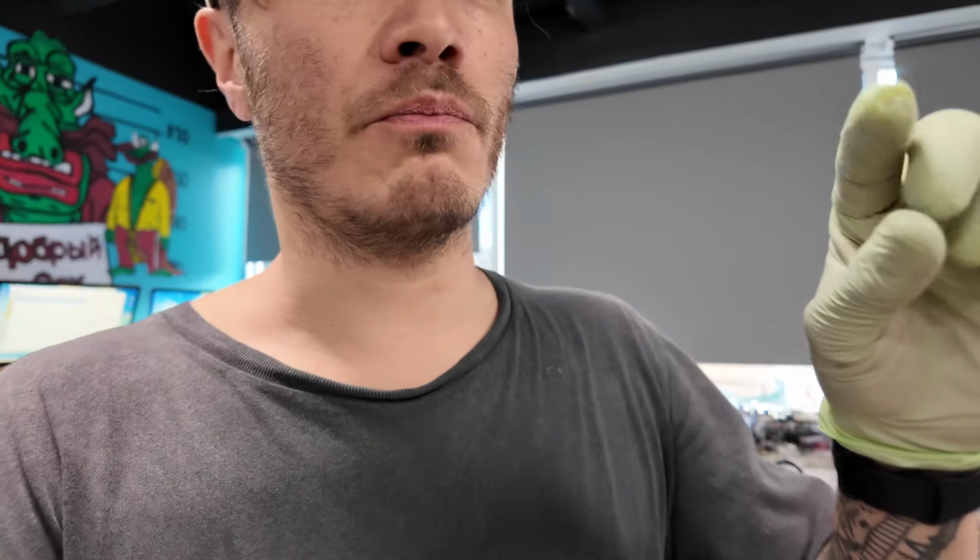Instead of getting donors, what we often do is we would use cases that didn't survive fully. So meaning that the head swap was already performed, but let's just imagine that one head died during the operation, but three heads remained. We keep these donors. That's why I hardly ever need to buy any new parts, because head assemblies, they're decapitated on the levels that are no longer functioning. All it takes is reprogramming the firmware a little bit so that the drive can work with that head assembly when it's modified like that.